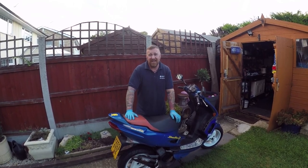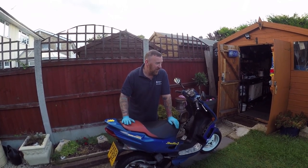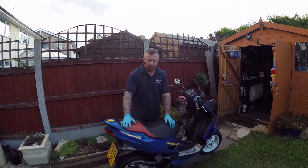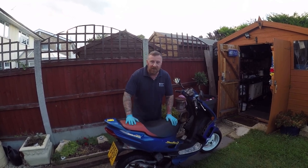And she told me it said 80, not 64 like I thought it said. So it's an 80 jet, which I suppose I knew it was bigger than what I thought it was. So I've put a 62 jet in here now, and guess what? Pulls away much, much better.